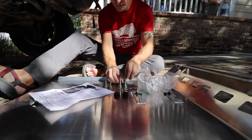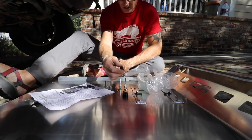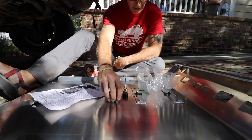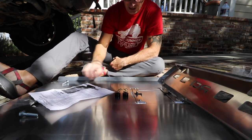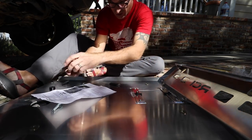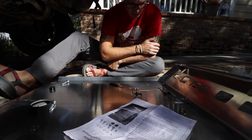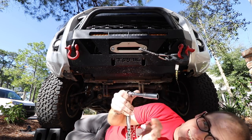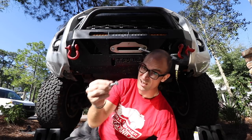We have two 30mm bolts, two 40mm bolts, four washers, and two nylon bushings that go in the back. The 30mm bolts go in the front, the 40mm in the back, washers in both places, and the nylon bushings in the back. That just about sums it up. Interesting side note — the vehicle's factory bolt was 12mm but the RCI hardware is 13mm.